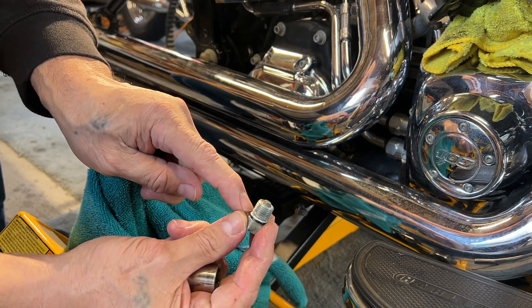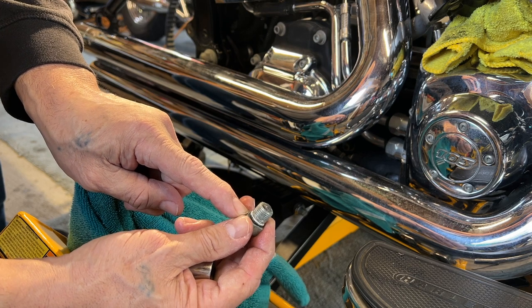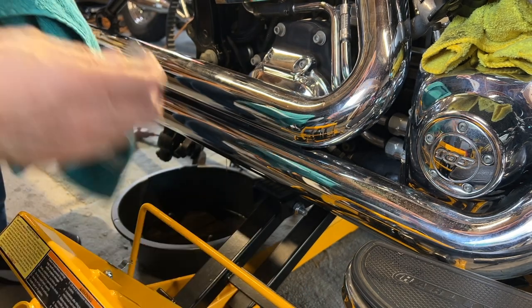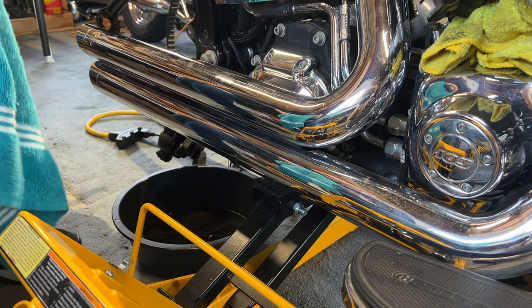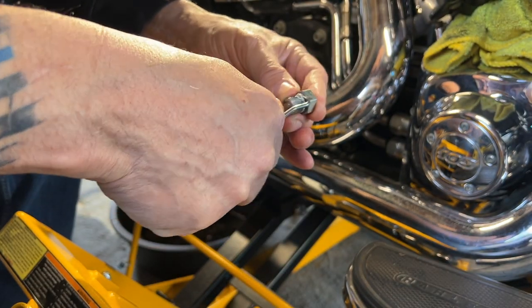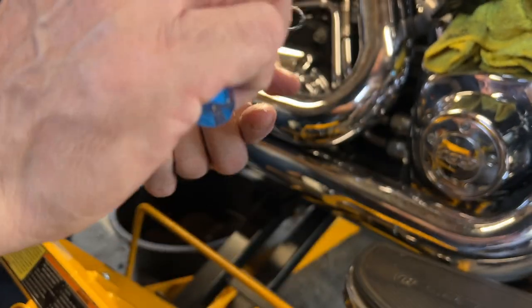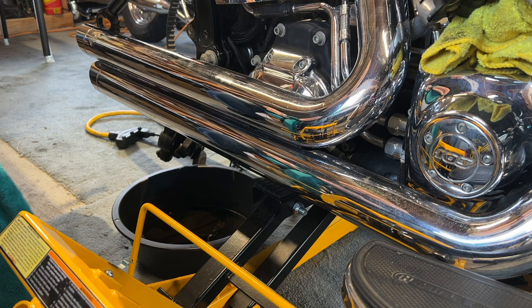Here's the plug, and here's the little O-ring. Somebody put some Teflon tape — like plumber's tape — on it, but you can see the O-ring is gone. That's probably one of the reasons it was leaking — that O-ring is pretty bad. We're going to replace it and let it drain really well. I get a little pick, take it off just like that — watch your fingers. Yeah, this thing is bad, it's pinched, there's really nothing left to it. We'll clean this off real good.